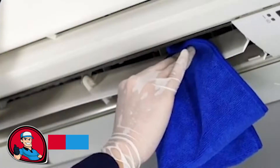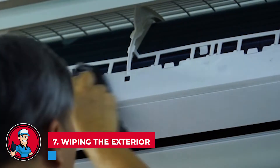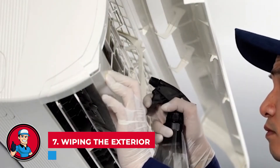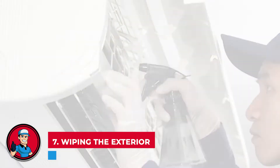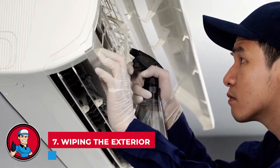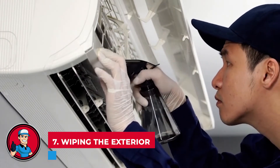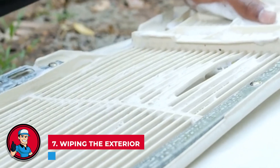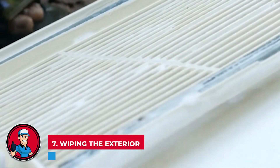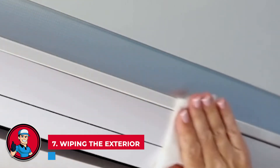Step 7: Wiping the exterior. Now, go back outside and work on the rear of your air conditioner and wipe down all parts. Using a coil spray and/or hose may be necessary — just be sure to check your user manual. If spraying anything, cover the inside vent to be sure the cleaner and water do not end up on the floor inside your home. It might take a lot more scrubbing and a bit more effort to get it clean, but just keep at it with a damp cloth and use plenty of soap during the process.